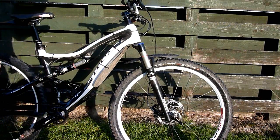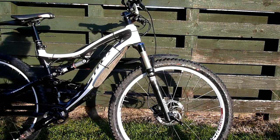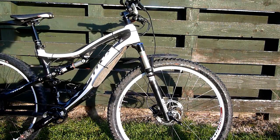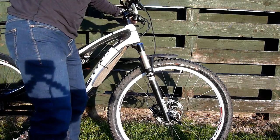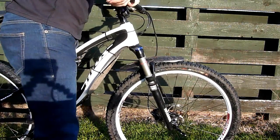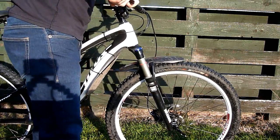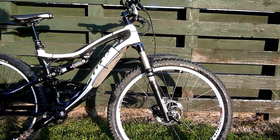This is a 100mm travel fork - we're going to change that to 120mm shortly, which will be in another video. Now we'll screw it all the way in and get a slow rebound. That's screwed in as much as I can get it. Maybe a slight difference there, but not a lot. I would probably have it set all the way in the way I ride. There you go - the difference.